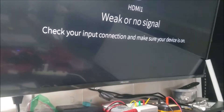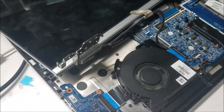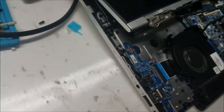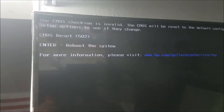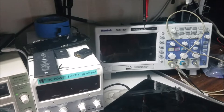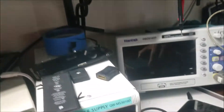Let's put it back. The computer is on — I'm going to wait for the picture. The computer restarted because we reset the CMOS battery. I can see something here. We still have no picture on the screen — I'm going to use the flashlight to see if it's just a backlight issue. I can see the HP logo under the flashlight.